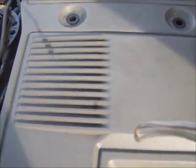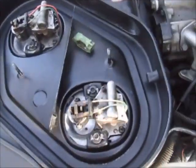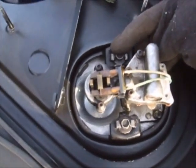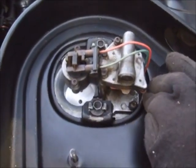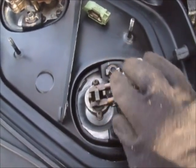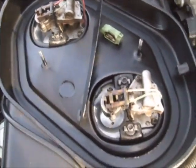Let's get those loose, clean her out, set her to the side. There are four 10mm bolts, two on each throttle body, that hold the air cleaner base down to the throttle bodies. I'm always real careful about these fuel injectors — dropping a wrench on them, I've done that a few times, so I'm pretty careful about that.